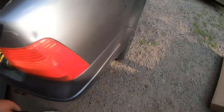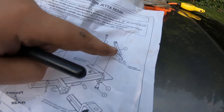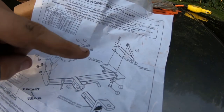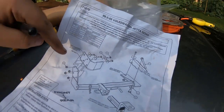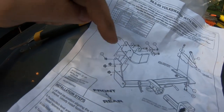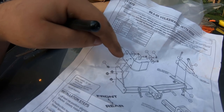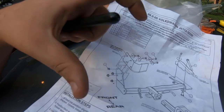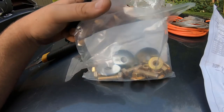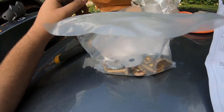So that's what we got. Got the hardware up here, here's the directions. This is the tow hook part on the car — you put a bolt right up there and I just have it hanging right now with the jack holding it up level. This is the trunk pan basically, and four holes get put in that and the bolt goes through. This is the big plate on the hitch and then it's just this thin sheet metal, so I'm thinking of putting a plate behind it too to really strengthen that up. The hardware kit has pretty big washers, but I'd probably have to get longer hardware to use the plate, so that might be a down-the-road thing.